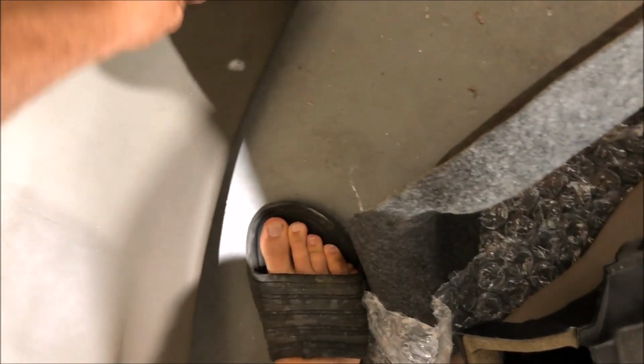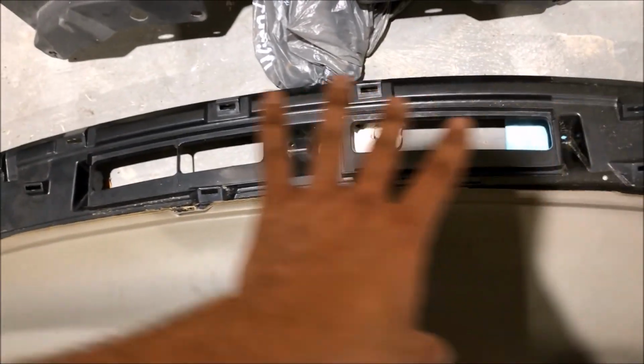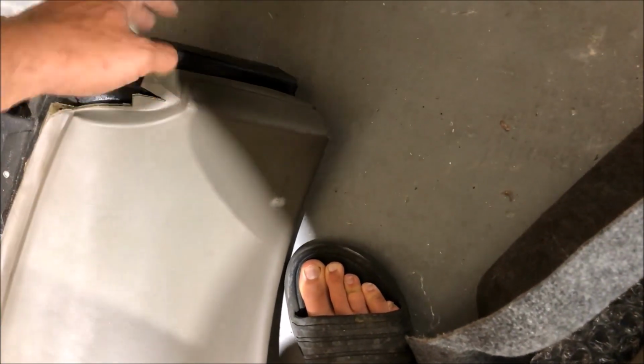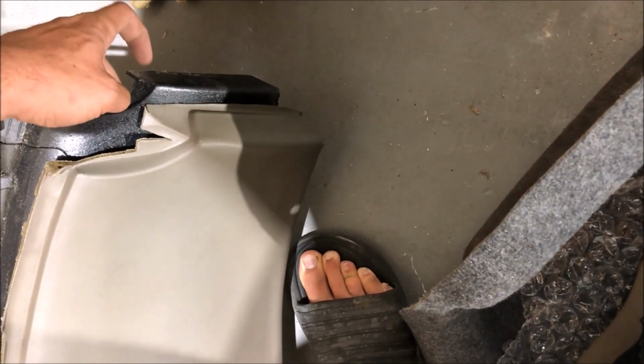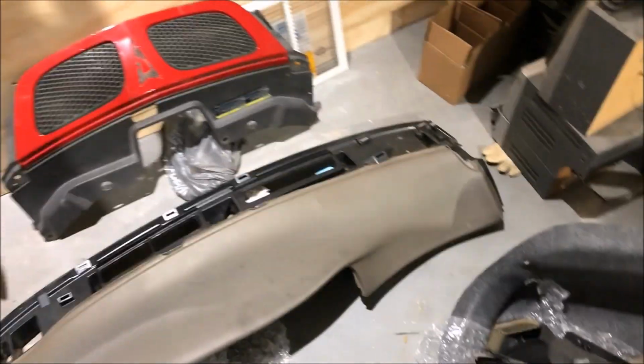but the screws will make sure this thing never pops up again. And I'm gonna have to shift this over a little bit as it's deformed over time. It's kind of slid to the left, the dash pad. You can see how it's way misaligned, but get this line back up again. And same thing on the side, run some screws that you won't even see. And this will be peel proof. It'll be like brand new again. There's no reason to order a new pad.